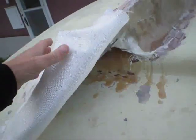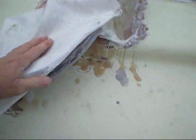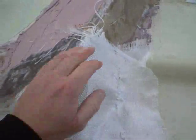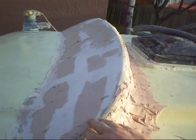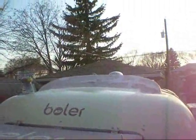So it comes down, it's attached right to fiberglass here. I was going to leave this end open but it's hard to get in there and sand it down and clean it up. So I've attached some fiber cloth here — it's been allowed to set overnight. I'll just grind down a line to follow the line here and attach that this morning, same thing on the other side. And then the front — the front's had its couple layers of fiber cloth. I've got a layer of Bondo on there right now so I've got to sand that down. There are a couple layers of Bondo on; I have to sand this down one more time with 80 grit. On the back here I've just got it roughed in right now.